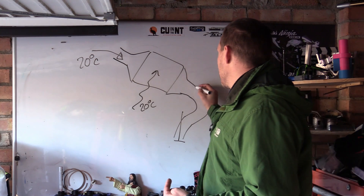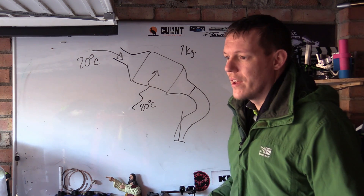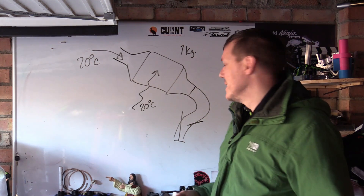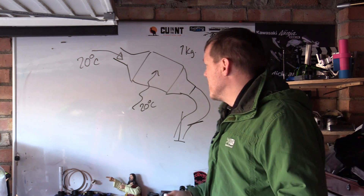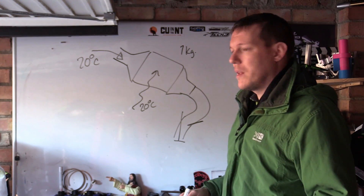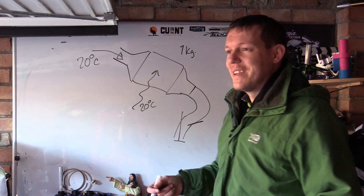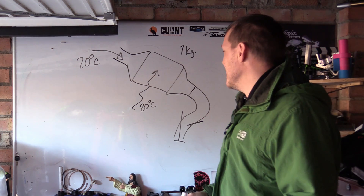So you've basically just added an intercooler which weighs kilos, added complexity, and all that. The other thing is your injectors are positioned to spray the back of your valves on purpose, so it takes heat from the valve and helps it evaporate. If you cool your fuel as well, you'll get loads of condensation and it'll mess up your mixtures, and you lose that valve cooling benefit.